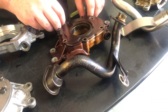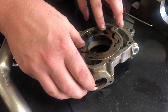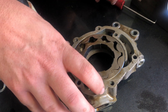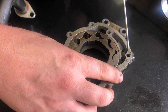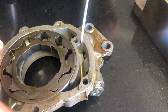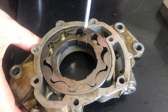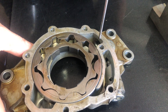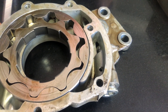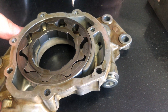Moving down this way, we have an oil pump that's come out of an L98 motor that's actually had an oil pump failure. What happens is right here is your oil pressure relief valve, and this valve right here is currently stuck in the open position. So oil will be sucked in here, pumped here, which should go to the motor, but instead it's being dumped and circulating around — which will result in no oil pressure, which will start to chew out your bearings, chew out your cam, and do a lot of damage.